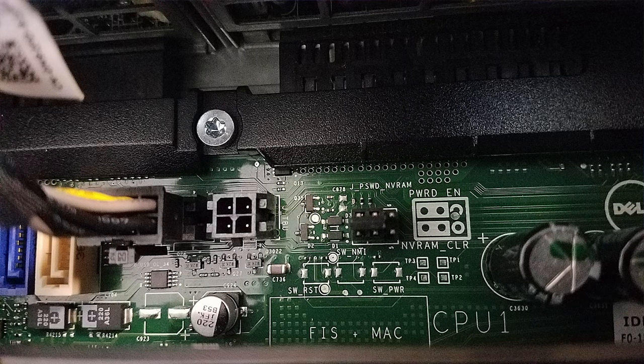Getting the servers up and running is a little more difficult when you're talking about repurposing a Google search appliance. In previous generations like the 710s, you could just flash the BIOS password with the pins on the motherboard. But on this one, you can't do that because Google disabled those pins on the BIOS. It's a custom Google BIOS and it comes password protected with a password that we're unable to obtain or flash.